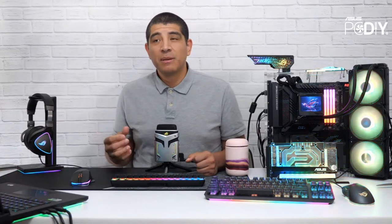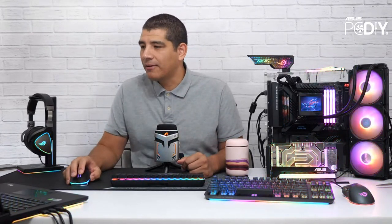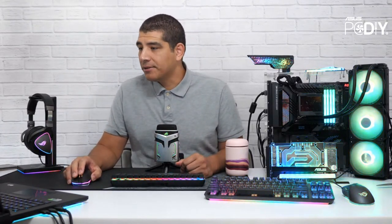Some of the SFX power supplies on the market are very high wattage, but they're not necessarily that quiet. So you get a very high performance power supply that's small, but oddly enough, you put it into a small system and it's maybe louder than an ATX power supply. It's an interesting situation, in that the SFX power supply isn't optimally suited to the form factor. So I think that's going to be one of the biggest strengths of the Loki series.